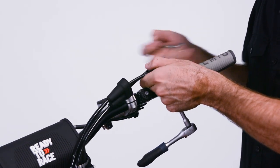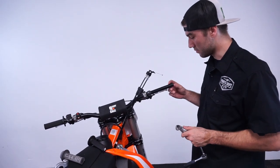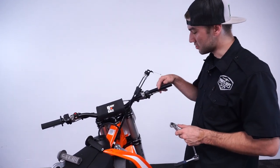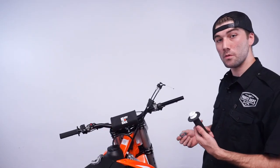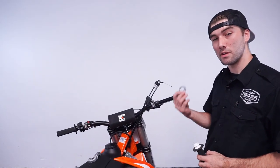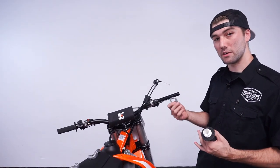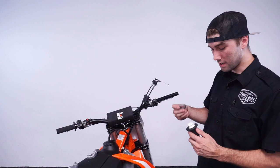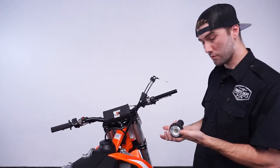When you pull your tube off, make sure you clean your bars before you put your new throttle tube on. Make sure there's no junk in there and your cables are working properly. For reinstall on your new ODI grip, make sure you have the right cam for your application. They provide a piece of paper with the grips that will give you the letter for your application bike. You just want to clip it on and reinstall.